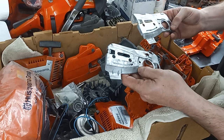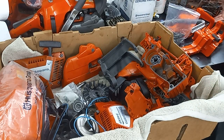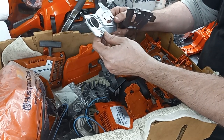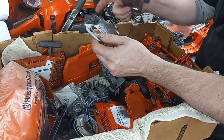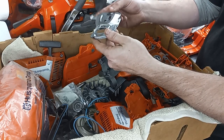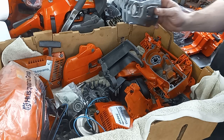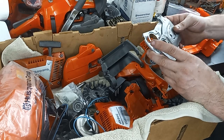Unfortunately, both of these have issues. This one's tore up here but good here — bad here, but not tore up here. This parts carcass that I have here has a good one on it, so I'll steal that one for the 346. Maybe I'll beat this down and lay a block of brass or something behind it, grain it and beat it all straight. Or I'll just beat it all in there and clearance it so the chain doesn't grab it again. I think the 350s are different — I think the 350 only has one hole.